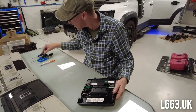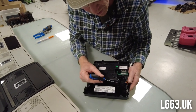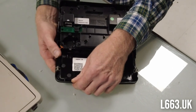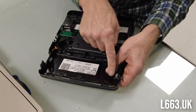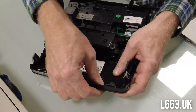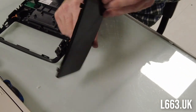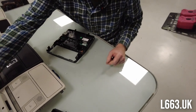So this is our console. You can see it's got these two long tabs at the back - they're not going to come out easily. The bits at the front here are clipped in at the front. There's enough flex to just push it down and push it up. If you push the frame away, you can just pop that up. Pull the frame away and go down - there you go. These rear little tabs pull out. So you can see that's how that pulls out, and that is just a bit of shiny plastic. We don't need that anymore.